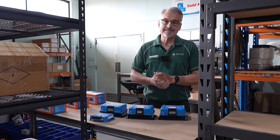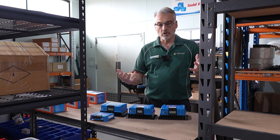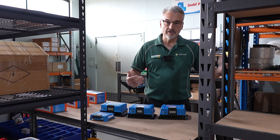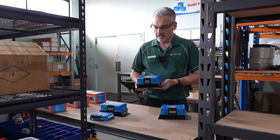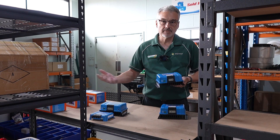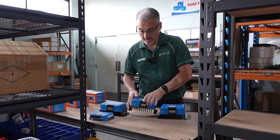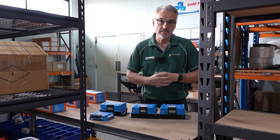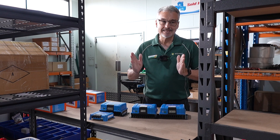In reality it doesn't make much difference which one you use — they do the same job. In applications like a boat where you can't chassis ground, you really need the isolated version with a negative in and a negative out. In automotive applications with a chassis ground, you just ground your negative and they're all common. With a non-isolated version, your negatives just need to meet together somewhere. It's really just a wiring difference; performance-wise they do exactly the same thing. Isolated is probably more common and makes a neater job, but the non-isolated is a little bit cheaper.